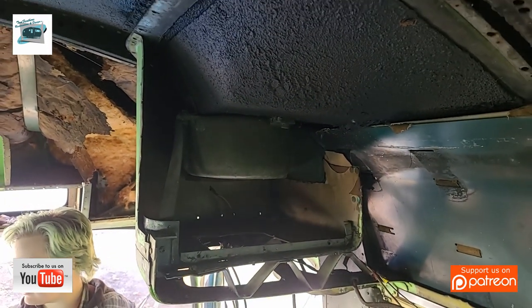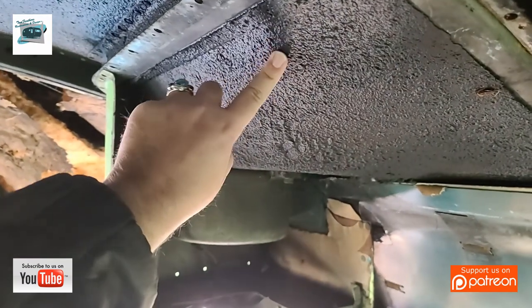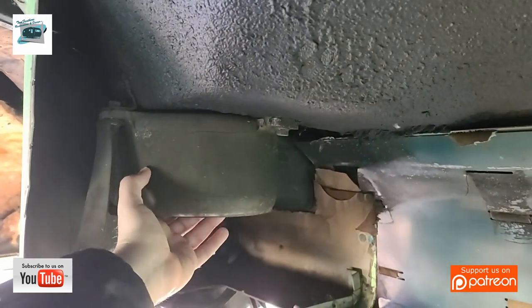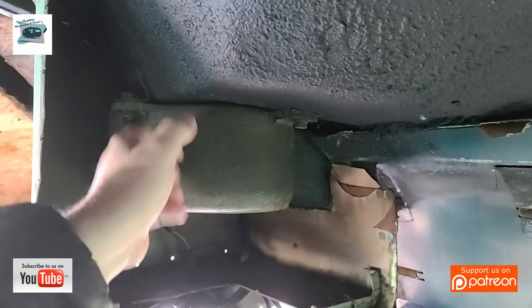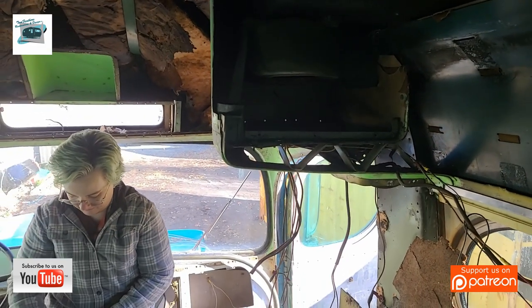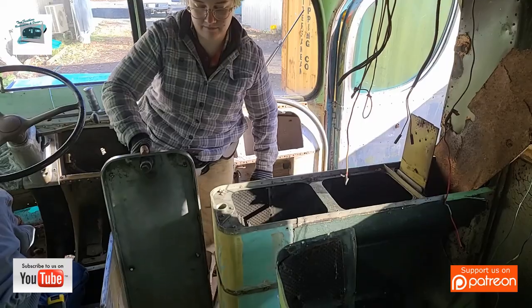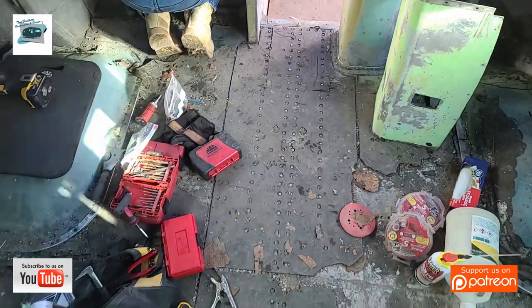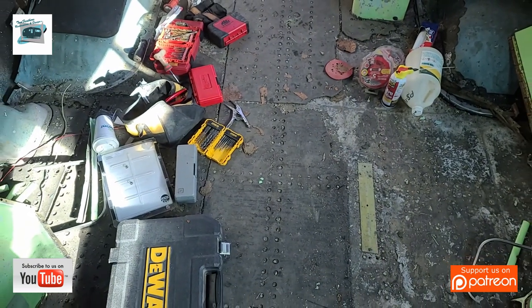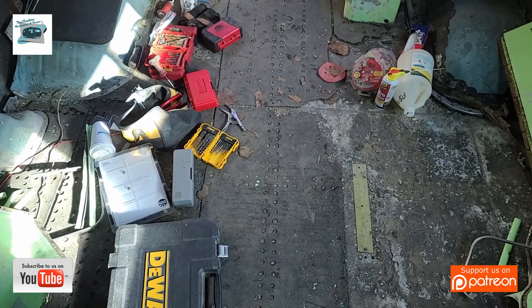If you've seen pictures and models of the bus, up front there's a grate in the roof — and that's what this pan is here. This has access to the outside air intake. Underneath here there would be a fan, which we've already removed, that allows you to bring fresh air in. So either this ductwork would have fresh air or heat, but also through the same tubing it gains access to what would have been the air conditioning as well — so heat or air coming through here. Through the center floor where the seats were is other ducting, and that cover plate strip would allow that to come up through the seats as well and dissipate, though not all buses had this.